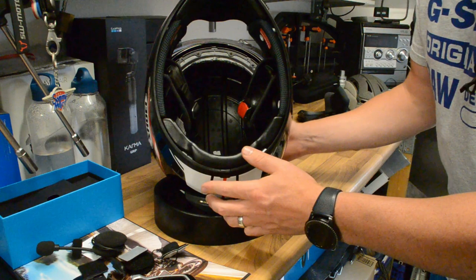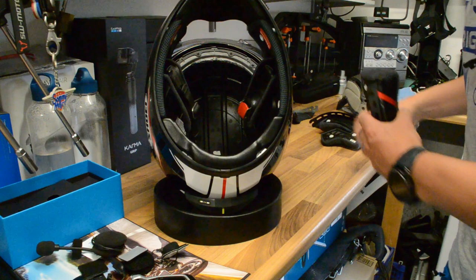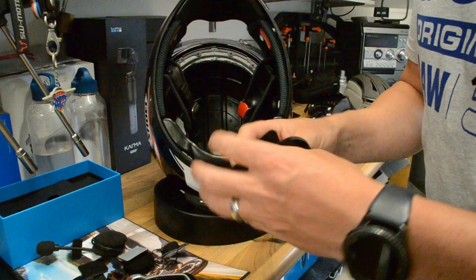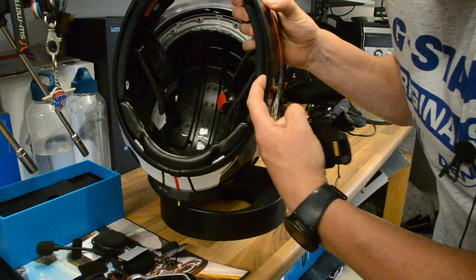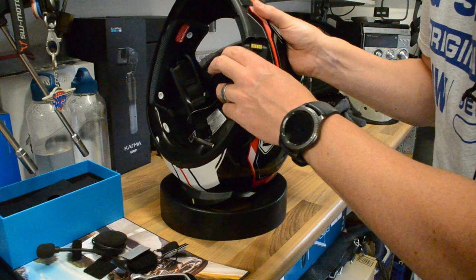I've actually removed all the inner lining of the helmet already — it's basically the headliner that just comes out of the top with a few poppers on the front and rear. I've also removed both cheek liners and the chin curtain, which exposes the whole interior EPS of the helmet and makes it easier to install. First off, we're going to install the clamp. You need to figure out which side to mount your unit — normally mine goes on the right-hand side. This clip slides in between the outer shell and the EPS of the helmet. Not all helmets allow this, so it may be that you have to use the sticky mount, which sticks on the side with 3M sticky pads.